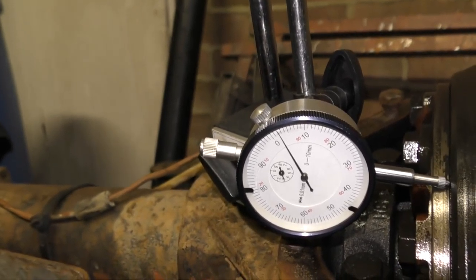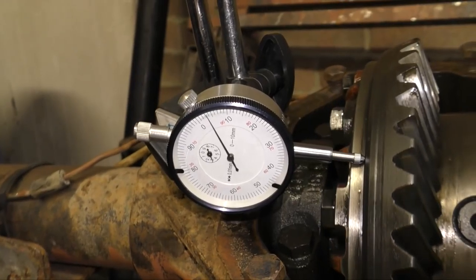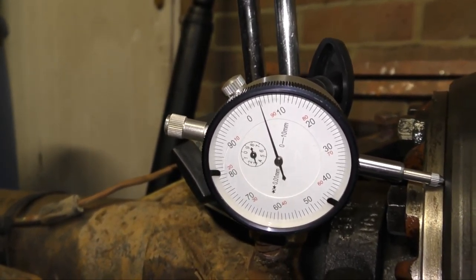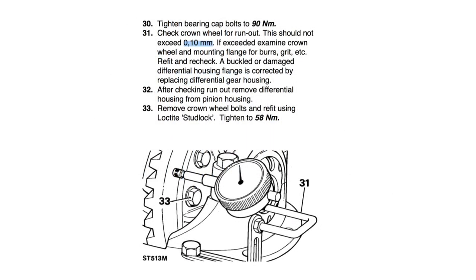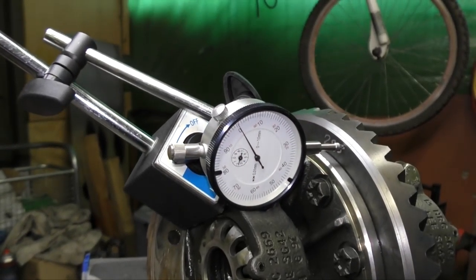Basically, we're just running on the edge of the crown wheel here, and that goes up to 0.05 of a millimetre, which is five hundredths of a millimetre. On the 90 or the 110 front diff, the crown wheel run-out is a lot more generous - that's 0.10 of a millimetre, or 0.1 of a mill. We'll set it up here and this is well within tolerance.